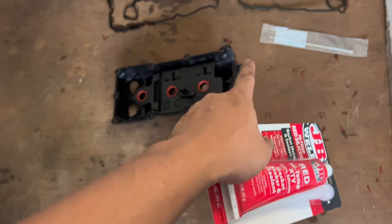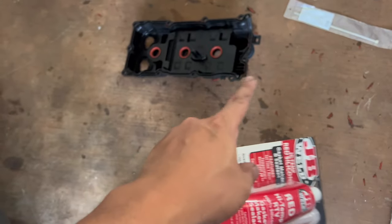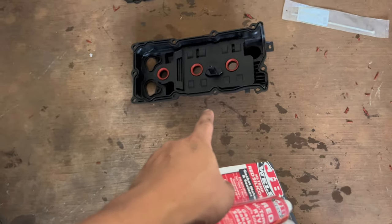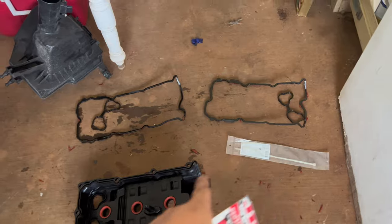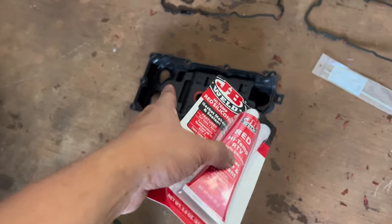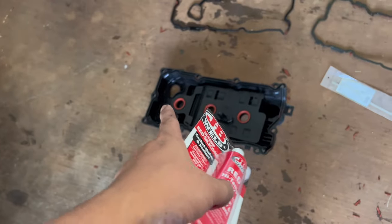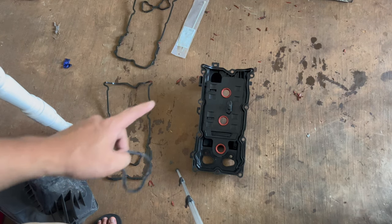We're going to start by putting in the screws — hand tighten everything first, and then I'll tell you how to tighten it cross-pattern wise and the right torque spec. The reason for hand tightening instead of just using a socket is you don't want to strip it — always good to hand tighten so you don't cross thread it. So we lightly hand tightened it — not tight at all. We're going to tighten it the right way. We'll tighten it until it grounds out and then do the torque. It's going to be one, two, three, four, five, six, seven, eight, nine, ten in sequence.